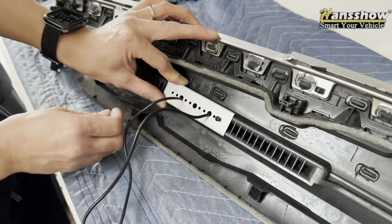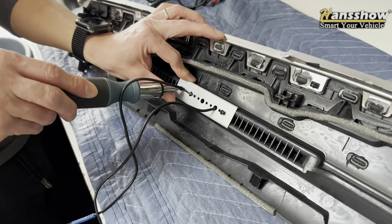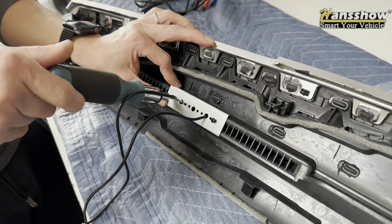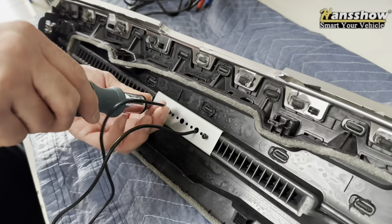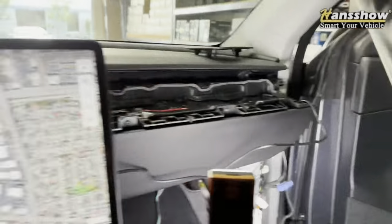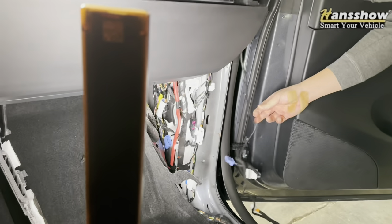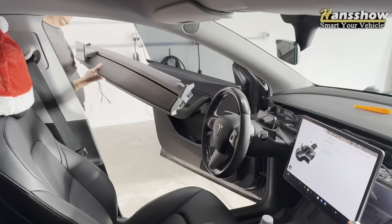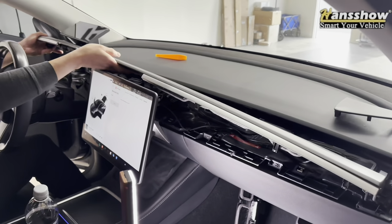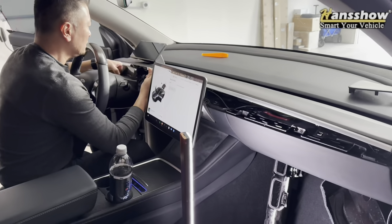This is where you will be screwing in the six Phillips screws — make sure you screw all of them in, and if you are missing one or two, two should be sufficient. Start from end to end; this requires a small Phillips screwdriver. Do not place the wire that connects to the display along the dash — run it down. You have enough length to reach the plug. Then go ahead and move your dash in. This is a critical part: when you place the dash on, ensure that your wires are not pinched with any clip on the dash or where the dash attaches to the vehicle.